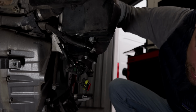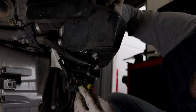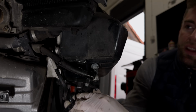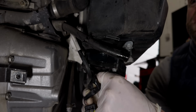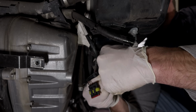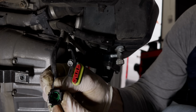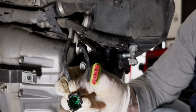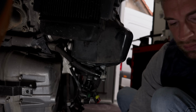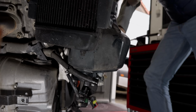Okay. And then we have this fuel line connector, so on both sides you have a green button, so this one, and on the other side is one as well, and you need to press them. Sometimes they're a bit hard to get out, but quite good, and you see if you press them. That's pretty easy to do, just a couple of connections for the hoses and the electrical connections, and then that's basically it. That's all you need to do.